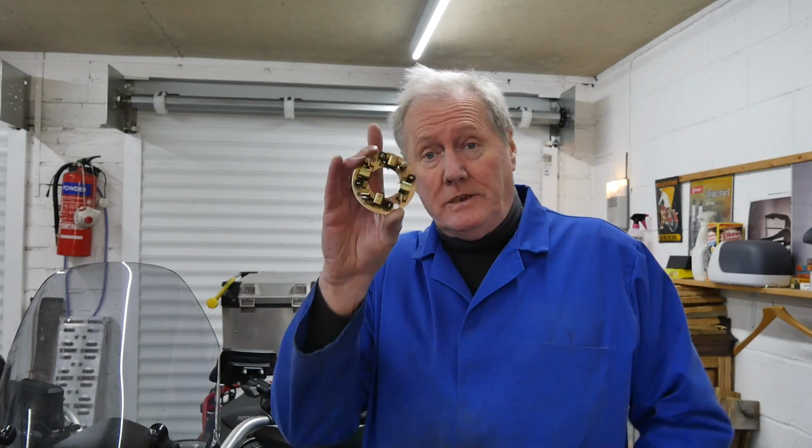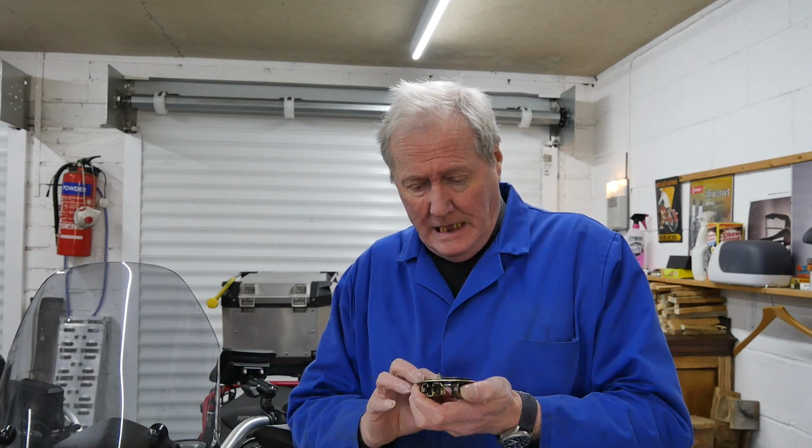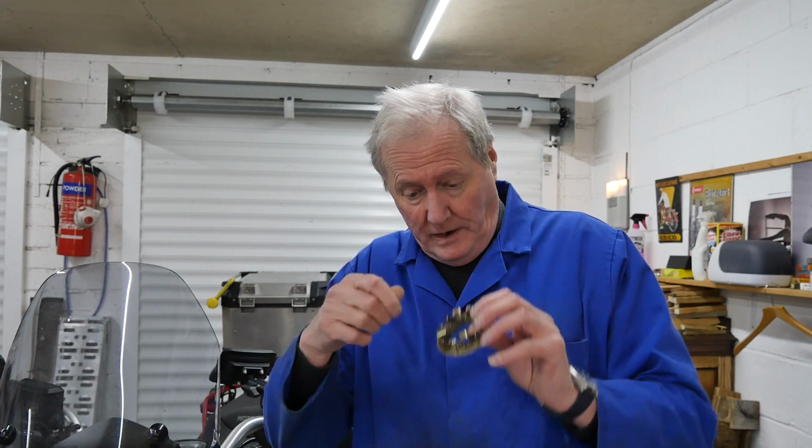A couple of interesting things have happened this last week. Firstly, I had to wait ages. I repaired the brush pack for the starter motor on the Morini, and I fixed it with a little tiny nut and bolt, which seems to be okay. Everything worked out fine when I tested it with a multimeter, so we've still kept the integrity of the insulation.